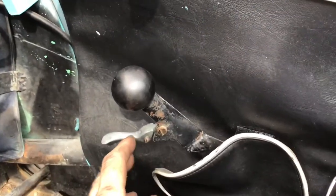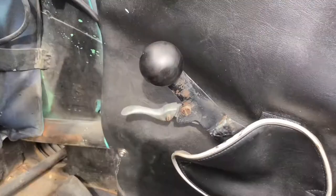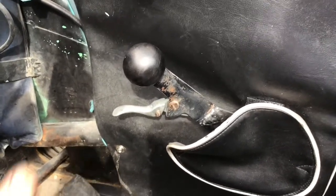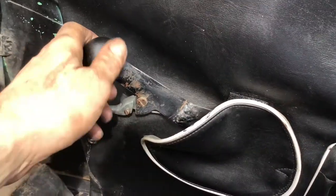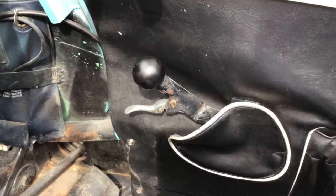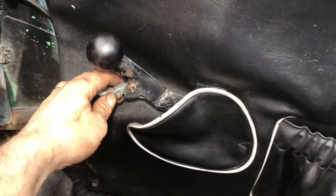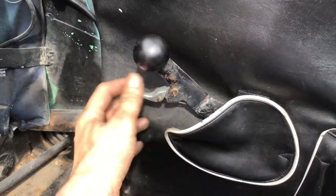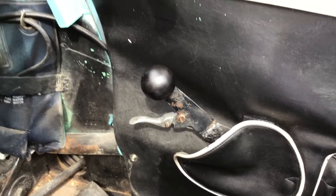You've also got the neutral selector lever here, which is on the end of the gear lever. The neutral selector allows you to take the car out of gear regardless of which gear you happen to be in. The gears themselves are sequential — like a motorbike — with first gear back towards you and then second, third, fourth going towards the dashboard. To adjust the neutral selector, you undo the screw here and pull — there's a cable just under there. This does need adjusting actually.